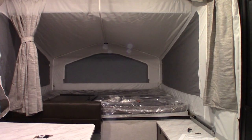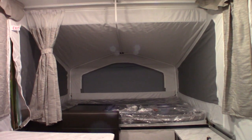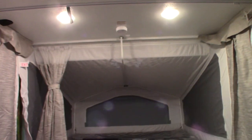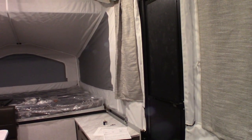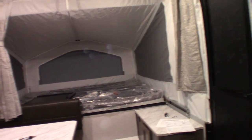One important thing to keep in mind is you want to inspect the seals on your trailer. Every place you see caulk from the factory, you want to look at every 60 days or so, just to keep ahead of things. On the outside, for example, there's four plastic corner caps. You always want to look at those and make sure there's no cracking or separation where water could get through. Look at the corners on the outside. Any place you see caulk from the factory, look at it, make sure it's good and tight. If not, you just buy a tube of the correct stuff and fix it.